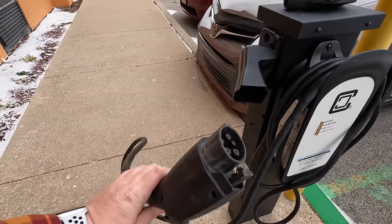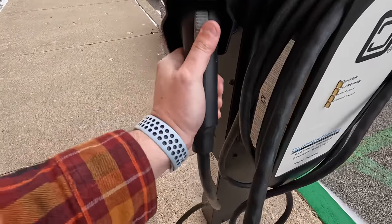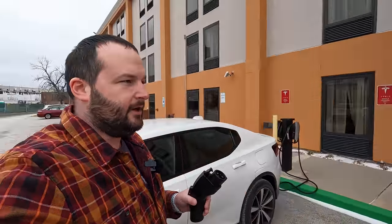I'll take that out here, plug it into the car, and we'll see how it charges. The very important scenario would be if there's no J1772 plug and there's only a Tesla plug — you're going to want this adapter to charge up your EV overnight. Also, sometimes there's a ChargePoint or Blink unit that costs 30 to 40 cents a kilowatt hour, so you're talking a 20 to 30-plus dollar charge overnight. But with Tesla destination chargers, they're always complimentary, so you're going to save money.